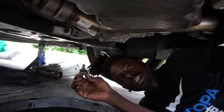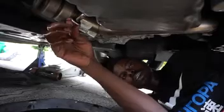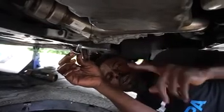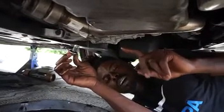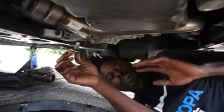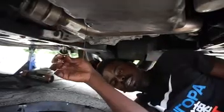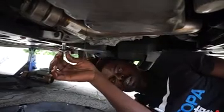Yeah, this little motor takes a lot of oil, way more than I expected. And also, the manual tells you wrong. If you put 4 quarts of oil in your car, it's going to blow up. You're supposed to put 5 3/4 quarts inside of your car. That way you have enough oil for your turbo and everything. What the manual tells you is just for the stock ST, not turbo, any of that. They should have something different inside of the manual that tells you otherwise though.